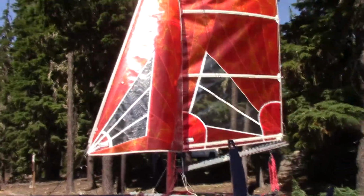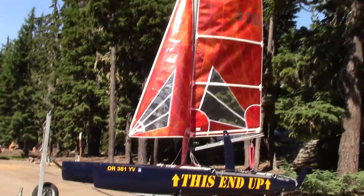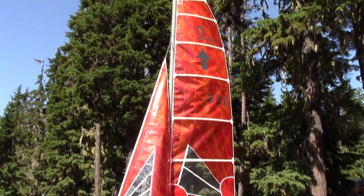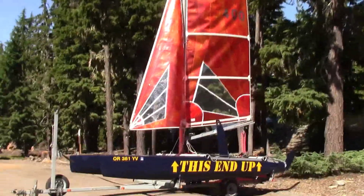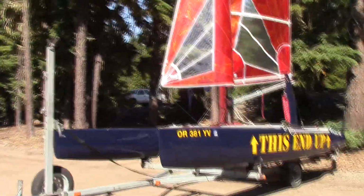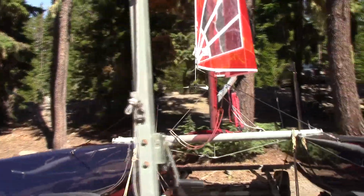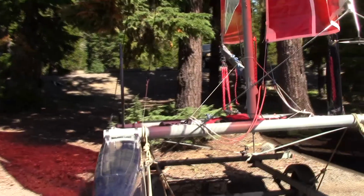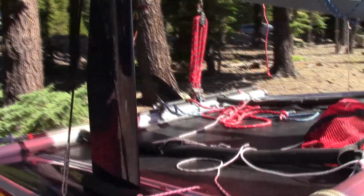So 41 years old, this boat looks new. It sails like a new boat, and you just can't hardly go wrong with a 5.2 that has been structurally repaired and improved for the most part. Some of the things that we did do is we bedded the cradles. One thing I've learned since I cracked one of the lugs is that the lugs in the early boats are bronze and they have extremely sharp edges, and I think that aggravates shearing of the lug out of the hull.